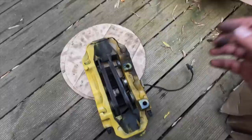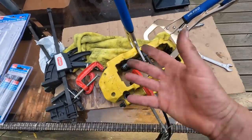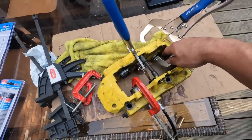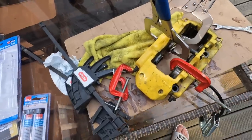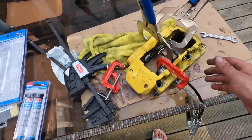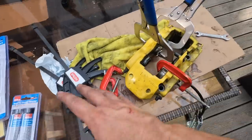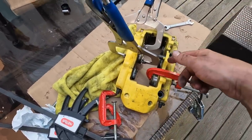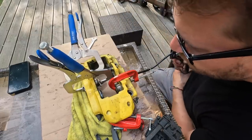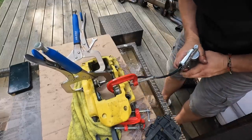The reason these calipers get thrown in the bin is nobody can remove the pistons — but I'm going to try a clever little trick my mate Pat told me. You'll have to excuse the mess; I've been trialing and erroring with various bits. This is my caliper — you can see I've got these little C-clamps in place. These two pistons were the ones that were moving; the other four were seized on this caliper. What we've got is a grease gun, a couple of cartridges of grease, all connected up with the pipe that comes with the kit — cost me about £15.